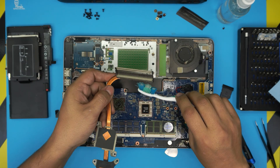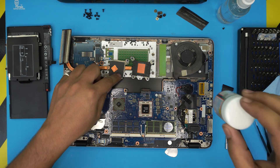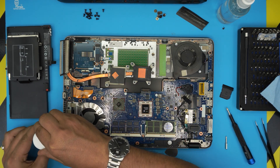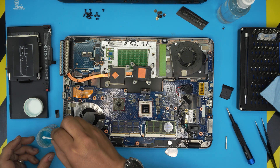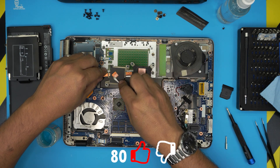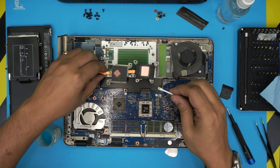Use a toothbrush and compressed air to blow through the heatsink — take it outside and blow compressed air through it. Now here's a little trick: because of the discoloration on the copper heatsink surface, there's a tiny layer that prevents heat from transferring properly. Grab a silver or copper cleaner paste or liquid and a cotton swab, then clean the copper surface to expose the actual copper so contact with the die will be perfect — you'll get even better results. Work quickly — about one minute — because exposure to air will cause discoloration again.